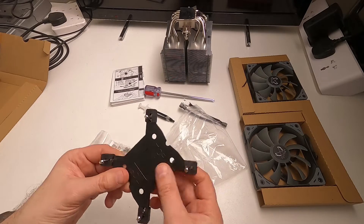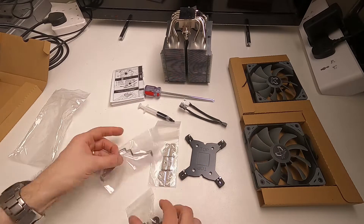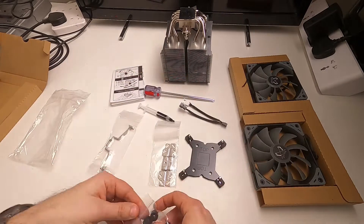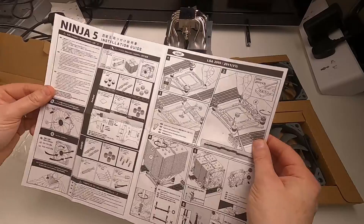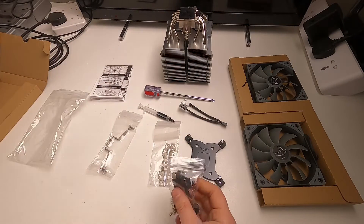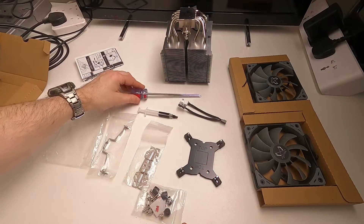The thinking seems to be that this is the kind of heatsink you put on and never take off, because it lasts forever. There are separate clips for the fans and mounting hardware. There's also a little 3M sticker — wondered what that was for. The manual actually identifies it clearly: it's a rubber spacer for socket 775. I like manuals like that where you have a question and it's immediately answered. You get everything you need, including the screwdriver, which is rather sweet.